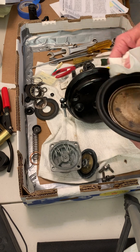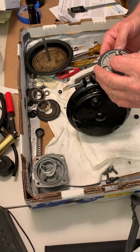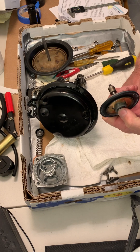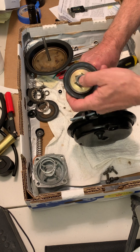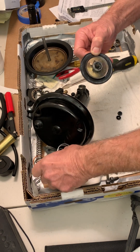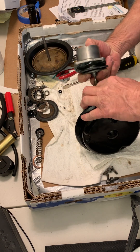We can't just put the vacuum on one side — that's not going to work. The point of this control valve is that it controls things. It goes in here like this, it's got these washers on it which seal it, and basically it determines whether there will be a vacuum inside this chamber. That's what this valve does — it determines whether there's a vacuum in here or whether this chamber gets vented to the atmosphere.